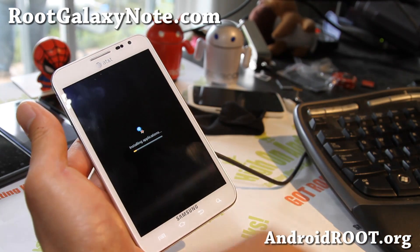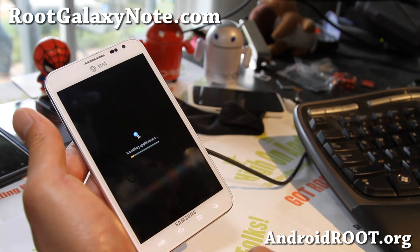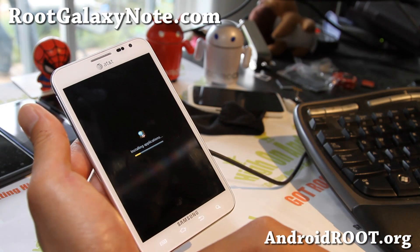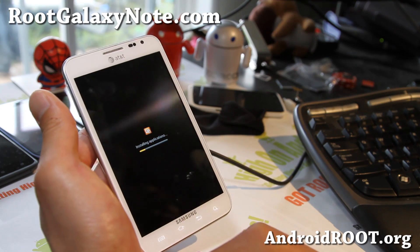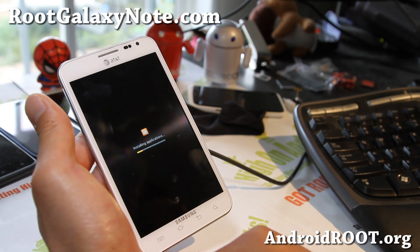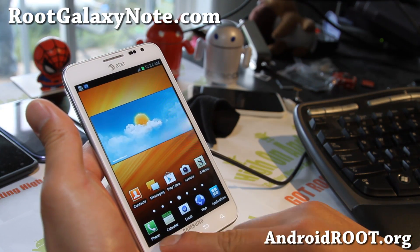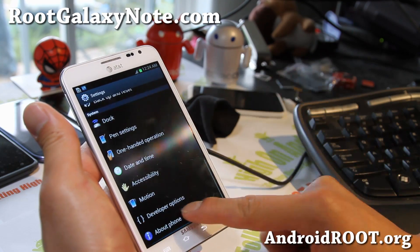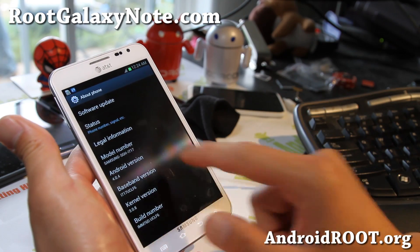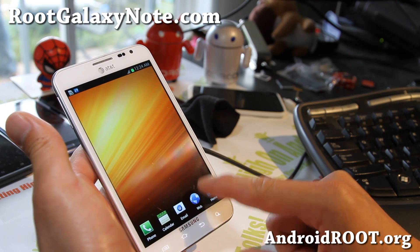I got it booting now. Once you see that screen, you should be all good to go — completely unrooted. Let's go to Settings > About Phone. You should be back on 4.0.4 UCLF6, which is the latest as of this video. Or at least the latest you can actually flash in Odin. If there's a newer update, you can flash this and then go to About Phone and do a software update, or use Samsung Kies to update your phone.